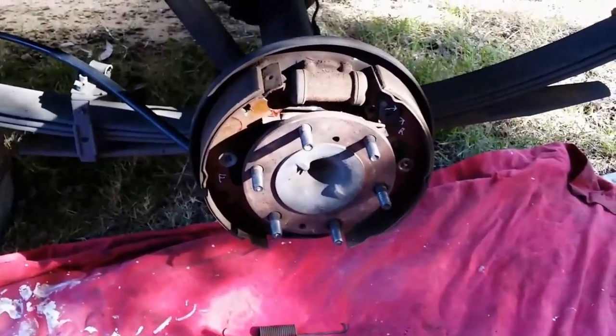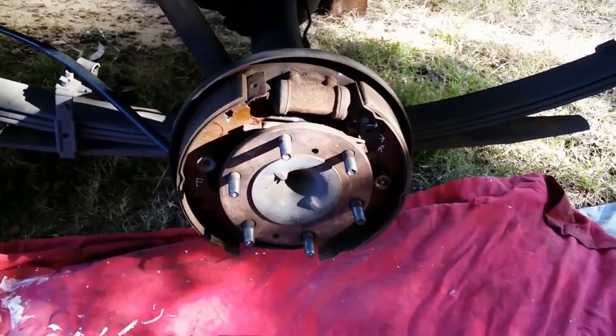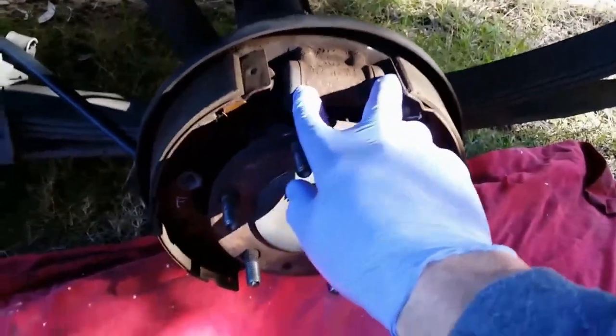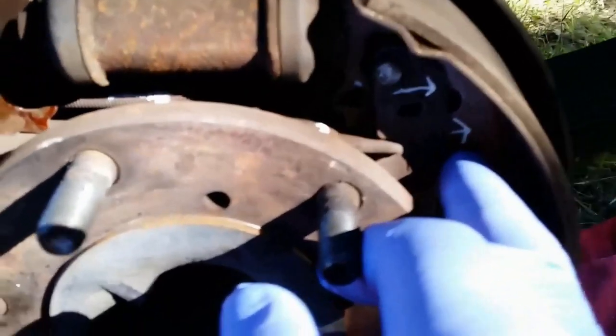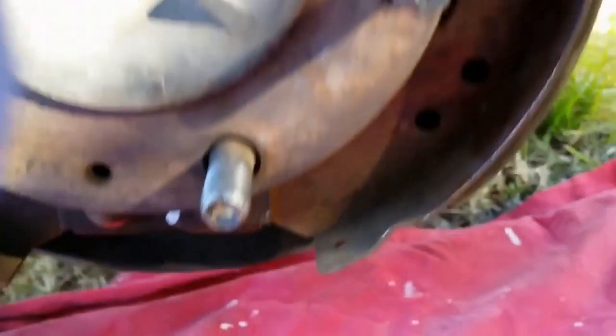With this job I highly recommend that you take lots of photos and plenty of documentation because there's a fair few parts to a drum brake. Some drum brakes have a different tightening mechanism and different spring setups. On this one you've got your spreader that spreads apart when you put your foot on the brakes, a rear spring to hold the shoes, a front spring that runs from there to the swiveling automatic tightener, and a spring in the bottom that runs across from one hole to the other. Check that for yourself, along with these retaining clips.